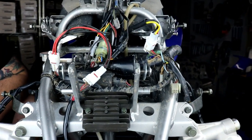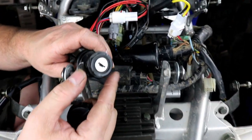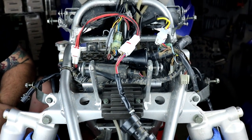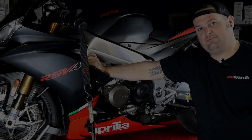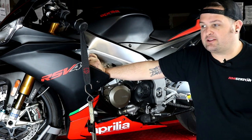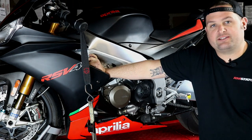Once all the wiring is done, get everything reinstalled. Put your key switch back into the fender — it's held in place with a plastic nut that removes easily. Put all your bodywork back on and make sure you put oil back in the motor if you drained it, and a new filter if you changed your oil. Make sure to like our videos and subscribe to the RM Stator YouTube channel — we want to keep doing new installation videos. Leave us comments and let us know what parts you'd like a video for, or if you have any suggestions or questions. Check out rmstator.com for our latest products and information.